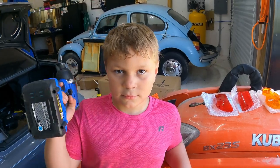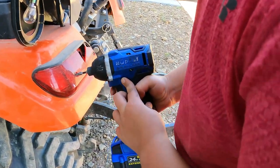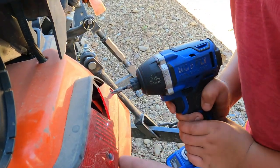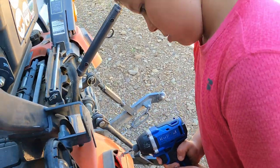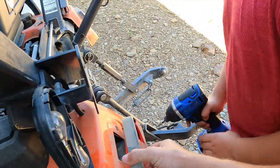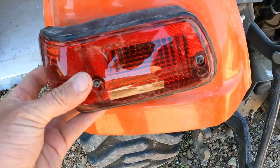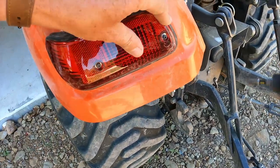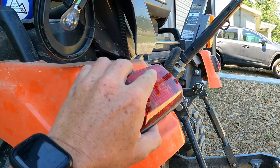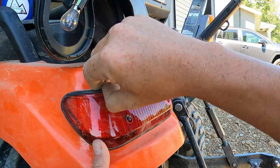All right, let's go take the busted ones off. Got her in reverse. Pull the trigger really softly. All right, we're loose. Well, there's the rest of our light inside there. So we got this put together and that'll go on there like that. You want to run the drill in real slow because you'll bust these lenses if you run them too hard. We've got to get that lined up in the hole and get the rubber seal in place.